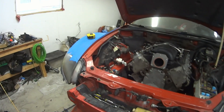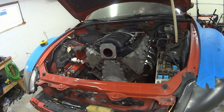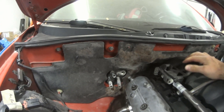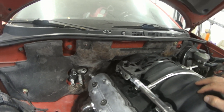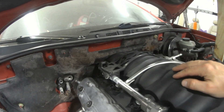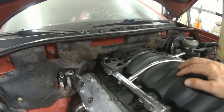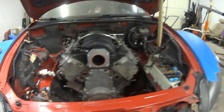Since yesterday I realized the hood actually does close, so there's no problem there. I now believe the engine is very close to where it's going to live. The last thing I need to figure out is it's been sneaking back a little, so now it's a bit tight in that area. I'm going to pull it forward, put the intake on, make sure there's clearance in that area, double-check it's centered, eye off the transmission, and then I'll start making the mounts.